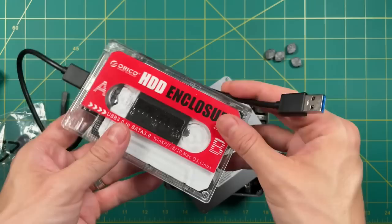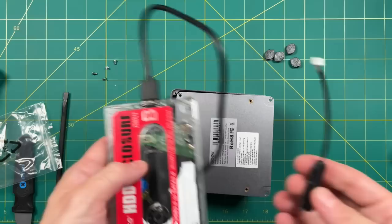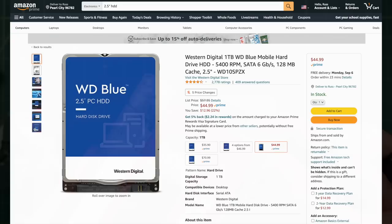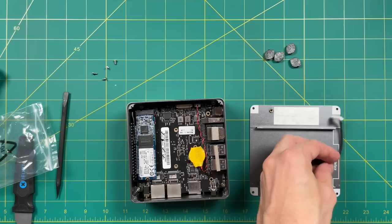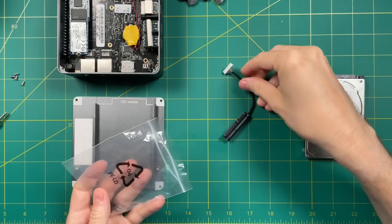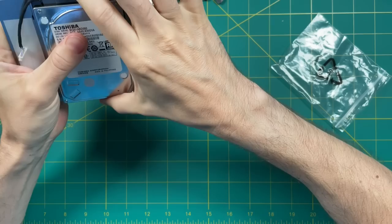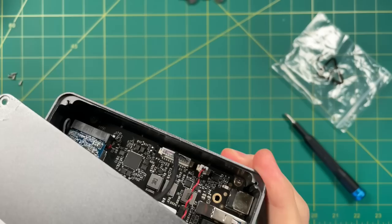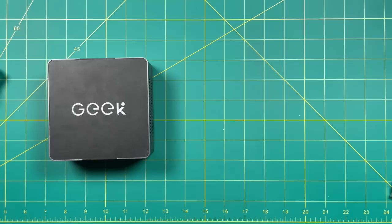Going back to the Super Console X, that USB hard drive could actually be taken out of its shell and placed directly into this device. So you could potentially buy that hard drive, remove it from its case, hook it up using the connector, and plug it in. But for this video I want to go DIY — do the whole thing from scratch. So instead, I'm using a one terabyte hard drive for under $50. I'm actually a cheapskate, so I used an old 2.5-inch PS4 hard drive I had upgraded years ago. All you do is fasten the hard drive to the bottom panel, plug it into the wiring harness, and plug the other end into the PC. That's it — you've installed the hard drive. Screw the cover back on, reapply the feet, and we're ready to rock.